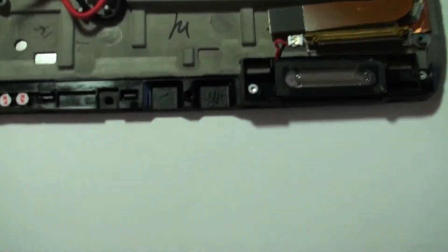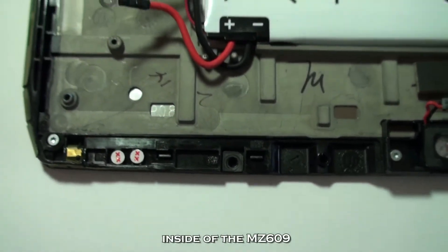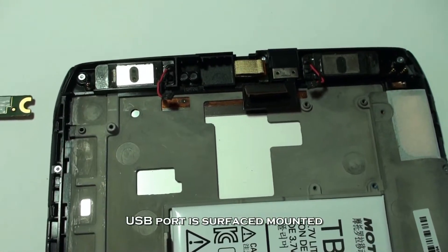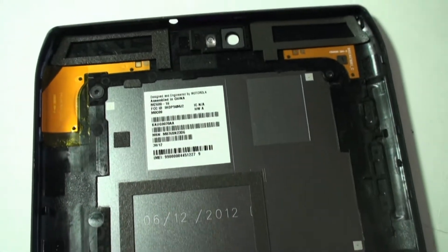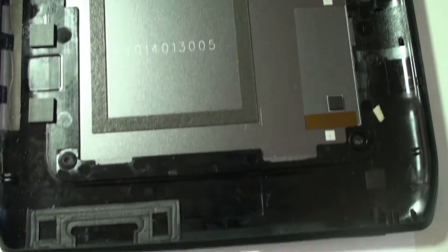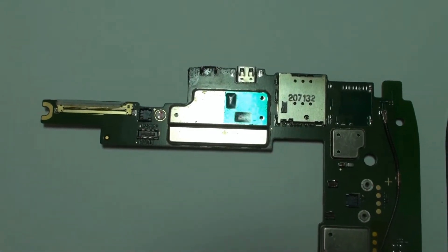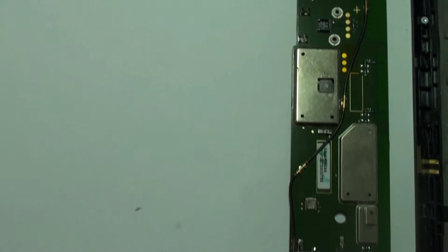This is the insides of the MZ609. It's a nice tablet, except the USB port is surface mount, and this is the Achilles heel of another tablet with lifting-off USB ports. That's the back cover held on by hex screws, there you can see. We reinforced the port and put it back together.